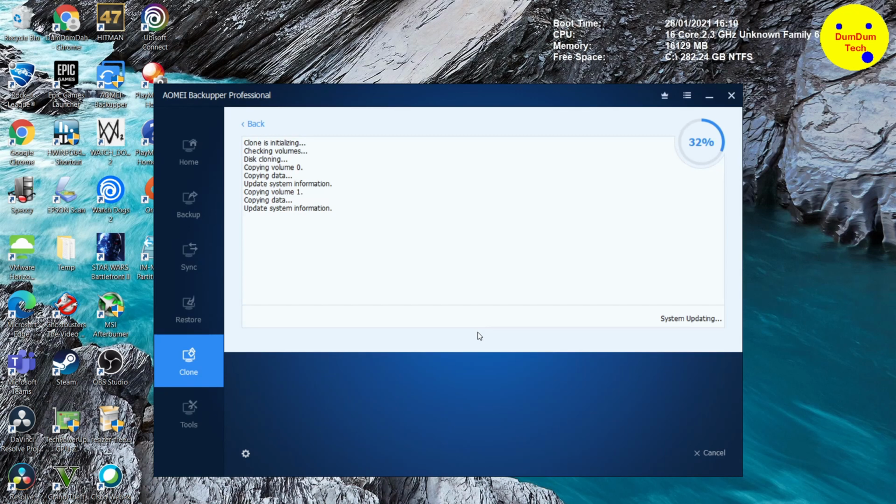It's going to assess the volumes from your C Windows drive to the new drive. Okay, so I bought the professional version. I wanted the partitions of the original disk to be copied exactly, not wasting any space. But the professional version didn't do that. I tried manually and auto size is just wasting space. If you have one partition of 900 megabytes, it's going to double it in size, and that's wasting space. So I would go with the free option.